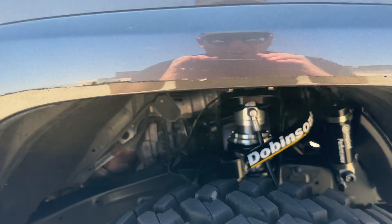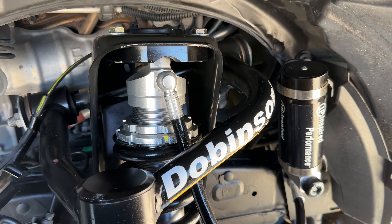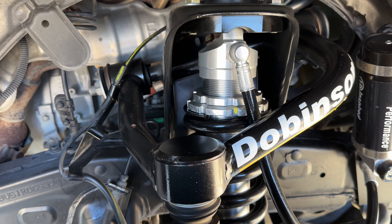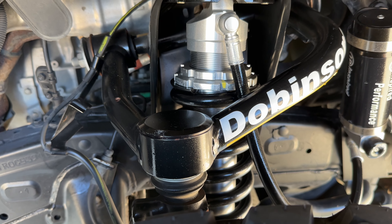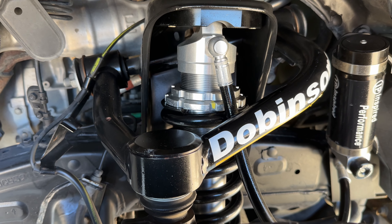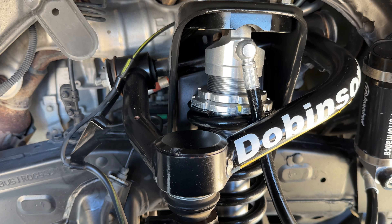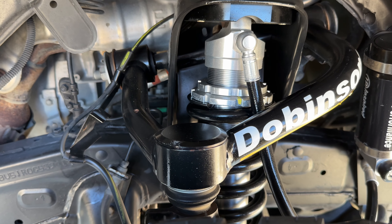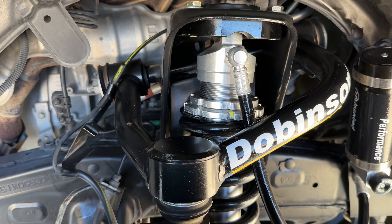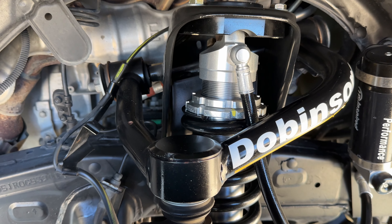Getting into the suspension — the heartbeat, the bread and butter — I have the Inspired Overland coilover with reservoir suspension, adjusted to approximately 3.4–3.5 inches up front. I have Dobinson control arms, however they don't give me enough caster and they give me negative one degree of camber. Shout out to Inspired Overland — they sent me their new fully adjustable upper control arms, which will be going on likely this week or next to get complete adjustment and control.